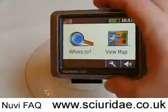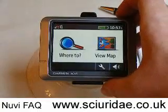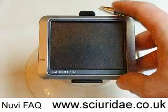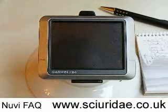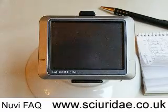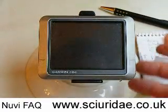Now the other way to do it is to do a user data reset as well. Now it's a bit more complicated, but if you have any trouble with your GPS reception, the device doesn't seem to be working properly, and you need to just really almost start again from scratch, you do a data reset. Now this will remove your settings from the device as well, but before you tend to phone Garmin or do anything else, this is the first place to start. Now the way you do data reset is a bit different.